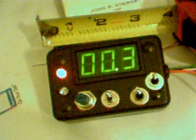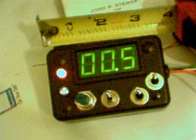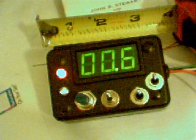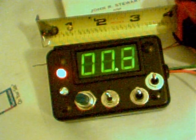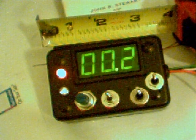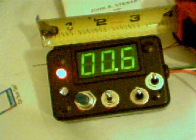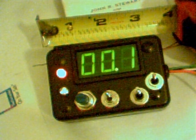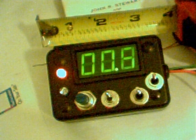We've got a pre-cat O2 sensor simulator, or EFIE — they basically do the same thing: interfere with the signal line going from the O2 sensor to the ECM. We have our power-on light, oscillating voltage, and a meter set up so you can see what's happening. We played around with a couple of EFIEs and O2 sensor simulators found online and found they usually did nothing more than lock the car into open loop, create a rich-only or lean-only condition. We had a hard time keeping them in the mid-range for normal operation, so we came up with this device to give full versatility — lean, rich, and everywhere in between.